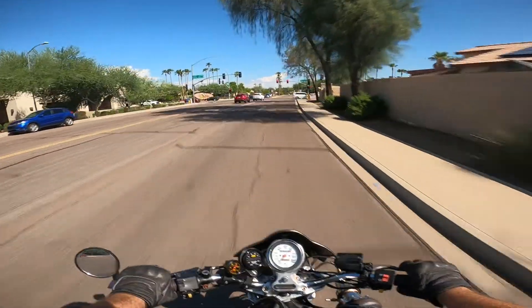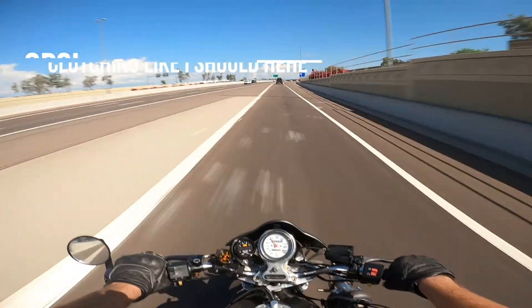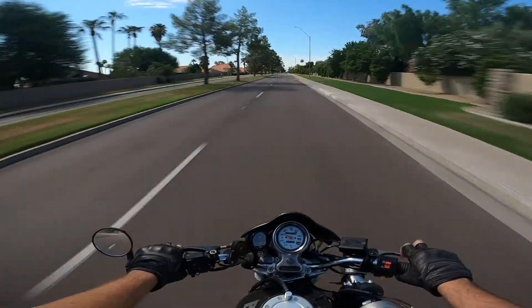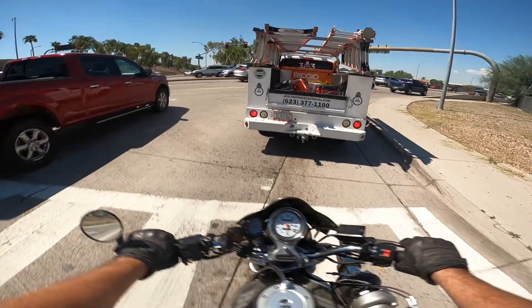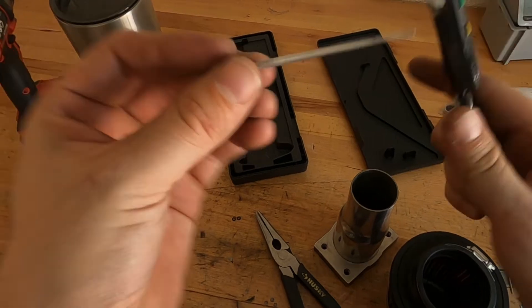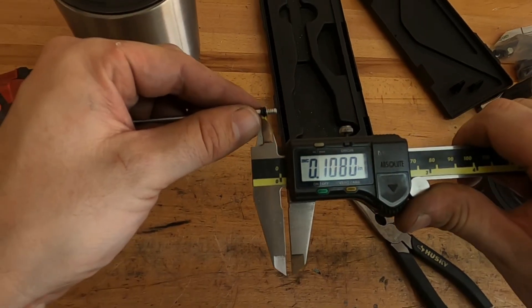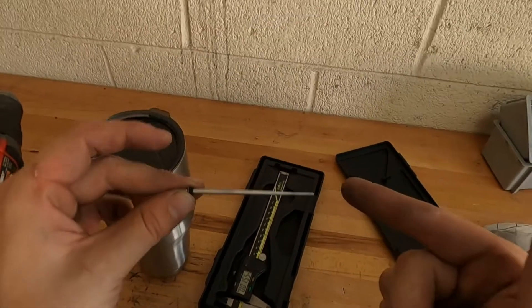It's day two. The only thing I changed is I added more boost. I need to adjust the needle on this bike — I need to sand it a little more because leading into boost, I can tell the needle is still too lean. Back at the garage, there's our modified needle. It was 116 right at that mark when I started, we're at 110 now, so I took off about six thousandths. The O-rings are going to space it up about a hundred thousandths — they'll probably squish a little bit, by like five or something, so about a hundred thousandths. I'm going to go ahead and throw this in there and I think we're going to be good to go.